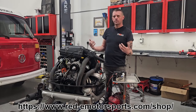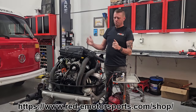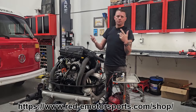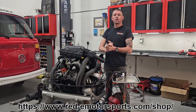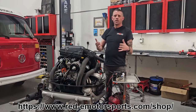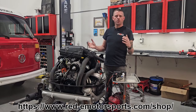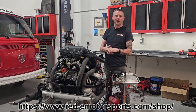If you're going to haul a bunch of weight and want to be extra safe, there you go. As I covered earlier, this doesn't take the place of an oil cooler — oil coolers cool the oil, they don't cool the heads. Now you've got a way to cool your heads as well. If you've got a real powerhouse in your bus and you put an external, thermostatically controlled oil cooler on it — that's the way I like them run so you don't over-cool the oil — throw this on it too and you have a bus you can depend on and enjoy. I hope this answers your questions. Email us or hit us up on Facebook if you have any questions about the system. We've got it dialed in pretty good and I hope you guys enjoy it and enjoy your cars a lot more, regardless of how hot it is outside or how far you're driving. Have a great day.